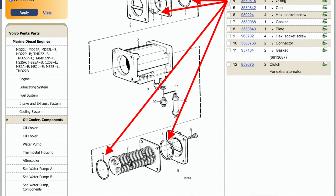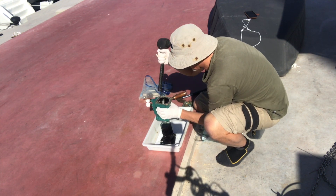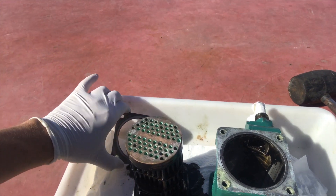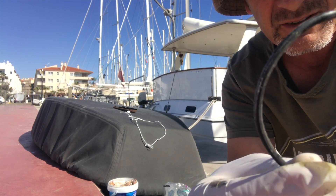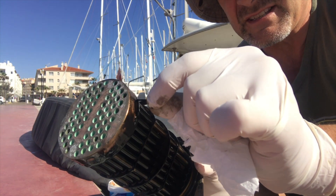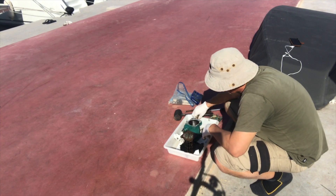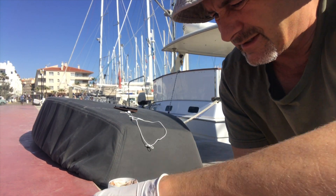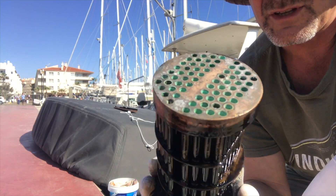Our next job was to change the o-rings, which meant removing the insert from the oil cooler housing. The seals don't look too bad — there is a little bit of melting going on and some flattened surfaces, basically where the rubber's melted onto the cooler. So I'm going to clean that off and replace them with new seals. The ones from Volvo were quite expensive — 15 euros for one little oil seal — but I didn't want to risk cheaper ones seeing as this is kind of a once in a two year service.